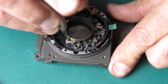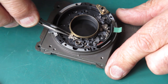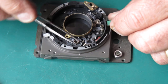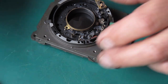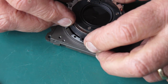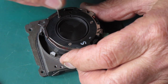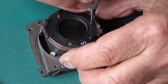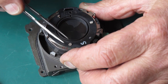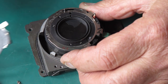We might as well take this bracket off. That's the bracket that holds the main spring in position. And we can take the main cam out of the shutter. And that's it from the front of the shutter. Now the rear of the shutter — three screws hold this plate in place. That plate away.